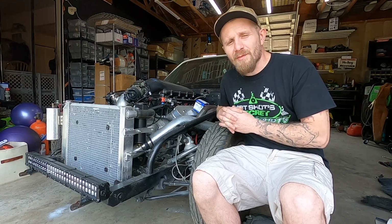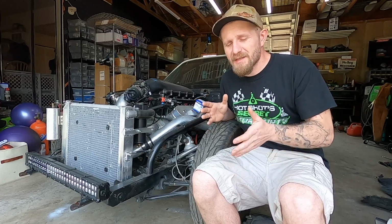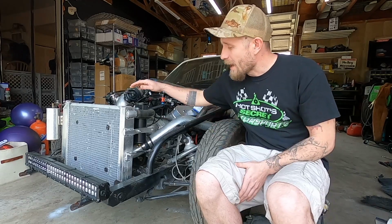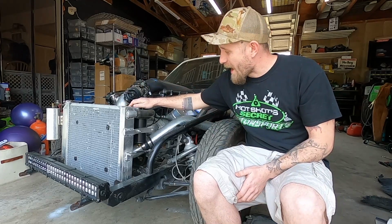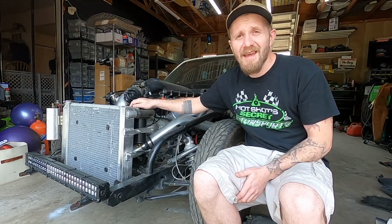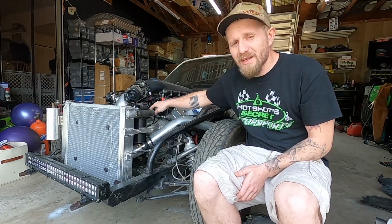At this point, I'm thinking we're just having an oil pressure problem, purely because of the fact that there's a bunch of ethanol in the fuel and condensation. I've got a catch can up here that about every two runs, or taking it out twice, gets a lot of water, a lot of moisture in here. I think we're going to end up redoing this system.